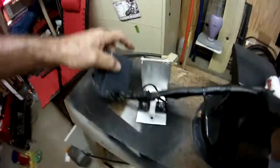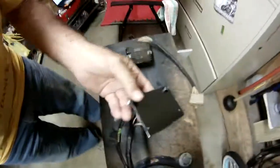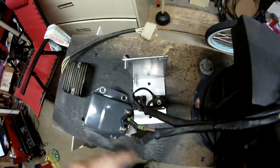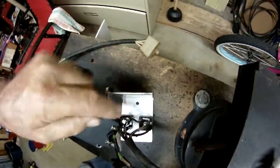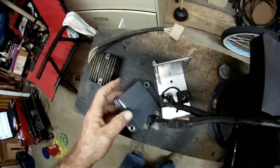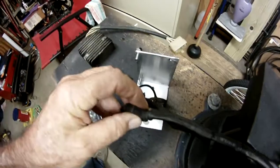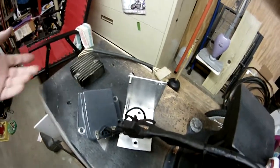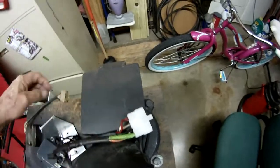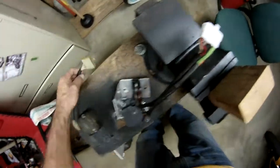I made it in two pieces so I can install it. See the two holes? That's the two holes I made. This is a piece of 4x4 aluminum — I painted the side we're going to see, so I'm going to need to repaint it. I'll have a link so you can see how this goes. Two positives, two negatives, the whites — they're actually up here now, they're clear, I got paint on them. Over here is the brown lead and the green lead. The brown lead has a 7-amp fuse in it. I actually have one in the fuse box, so it's going to be double fused. From Mike's XS, I bought another set of plugs with gold pins, soldered them in place.